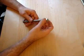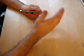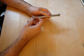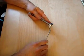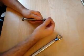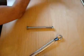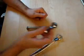And for those of you who know what this looks like underneath the car, if you've got a manual transmission, you just torque down the head of the bolt and then you're done. Okay, I have the automatic transmission, which means there's little to no room to get a torque wrench and a socket in there. So what I'm going to be doing, and I've already done this on the passenger side, is hold the head of the bolt steady with the wrench and torque down the nut. Now, you've probably seen underneath the car there's not a whole lot of room to torque down the nut because there's fiberglass in the way, which means I have to use this next piece.